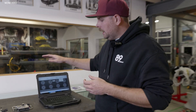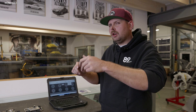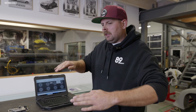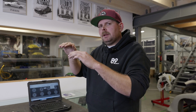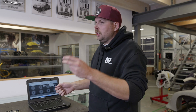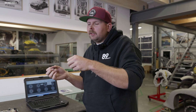I talked about all this with DMI and we said we have to find a solution to do this. DMI said, 'Okay, we just copy all the functions of an original ECU.' So in this ECU, if you turn on the lights it will notice the switch input and the idle goes a bit up since the alternator is working harder. The car takes more power from the alternator, the idle goes a bit up, and then everything stabilises — we just bring the idle back down, which is about 30 to 40 rpm, nothing crazy. On a normal MS, the moment you hit the brake the idle valve opens two or three percent just to keep the idle stable. You turn the steering wheel, the power steering pump works a bit more, it stresses the idle, so we turn the idle up. All this is in the Mini Plus.